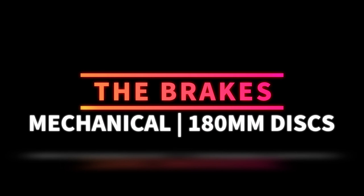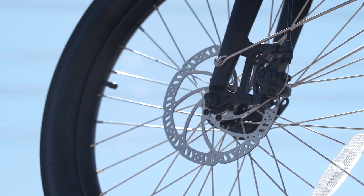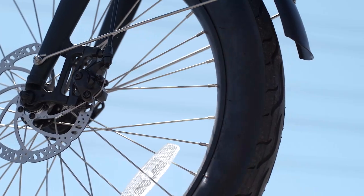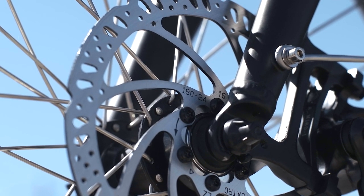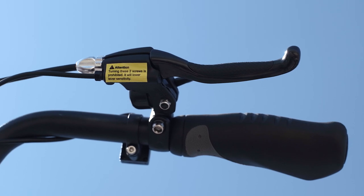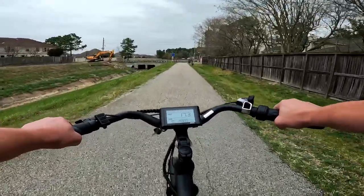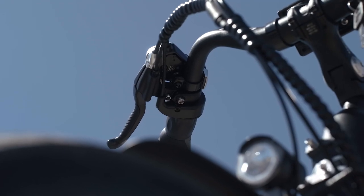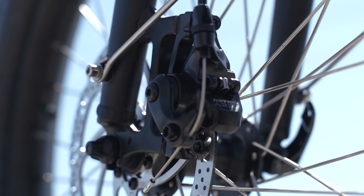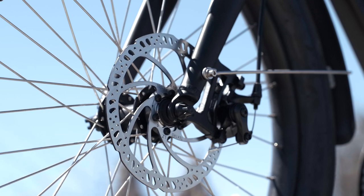Next, let's talk about the brakes. The brakes here are mechanical disc brakes with 180-millimeter discs on both the front and rear. With a bike going these speeds that's a little longer and heavier, and carrying cargo in the back, I would like to see this upgraded to hydraulic brakes — just for that extra layer of safety, and so you're not constantly adjusting as the cable stretches over time. However, in testing they held up well and stopped the bike exactly how you'd expect. With this use case, hydraulic brakes would probably be a good upgrade to make. Even though they are mechanical, they do have motor cutoff inhibitors, so when you apply the brakes it cuts off power to the motor — meaning you're not fighting extra motor power to slow the vehicle.